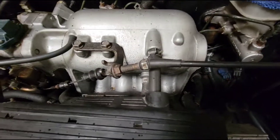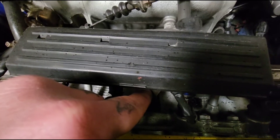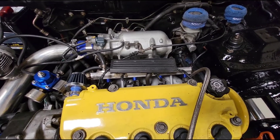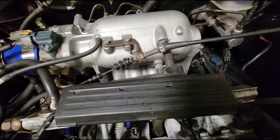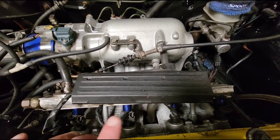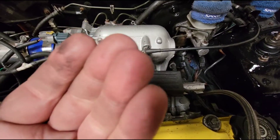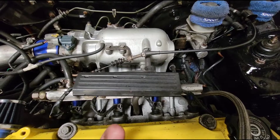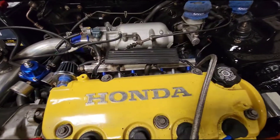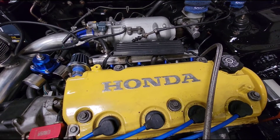This is the PCV system — it goes here, goes underneath, then goes to a PCV valve, which stands for Positive Crankcase Ventilation. A PCV valve is a one-way valve: it's supposed to let air out but not in. On an all-motor car at wide open throttle it sucks pressure from the crankcase. The problem is if that valve fails and you're boosting under pressure, you're going to be boosting into your crankcase, underneath your piston. As the piston is being forced down, you're forcing pressure underneath, which will crack your piston ring lands fairly quickly.